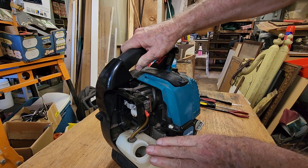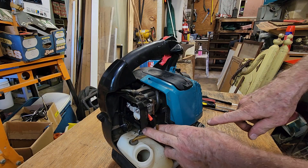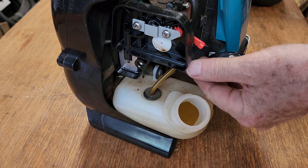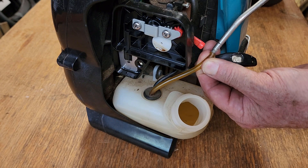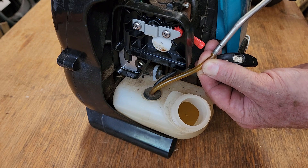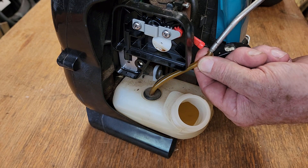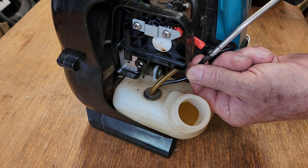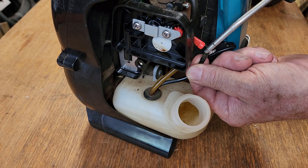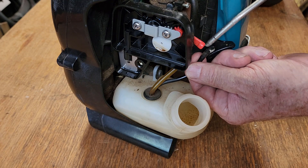Our electrics are okay. I've still got these fuel leads off so I'll blow a bit of air back through the fuel filter next. I've put some fresh clean unleaded fuel in the tank. The return line has no filter on the end of it, but this is the main pickup line — you can probably see the froth and bubble in the tank showing lots of good airflow going through the filter. That should have flushed anything out of the filter.